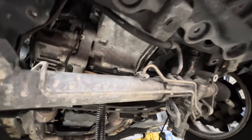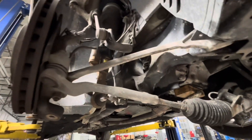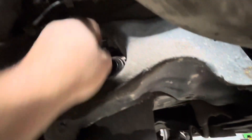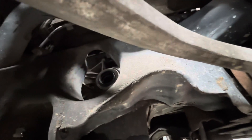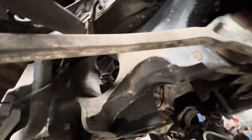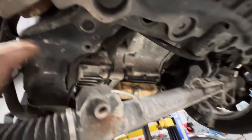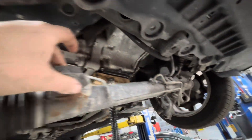So what I ended up doing is pulling the axle on the passenger side — I'm not sure there's probably another way to do this — because you can't get the engine lifted high enough with the axle in place. It bumps up against the frame rail here when you try to hoist the engine up. So with that axle pulled, and the other one's still in, it didn't touch the suspension on this side. I just pulled that chassis plate here that holds the steering rack.